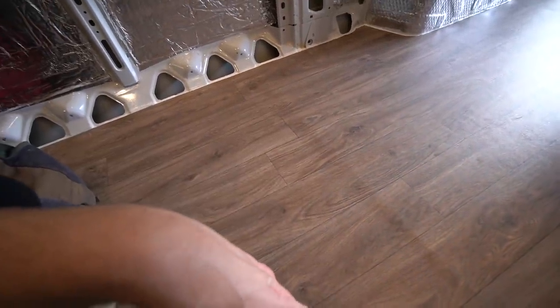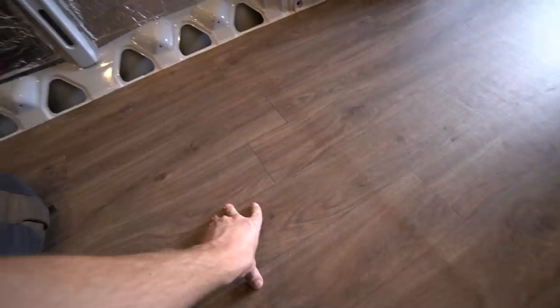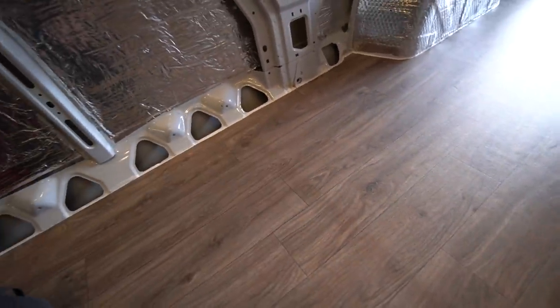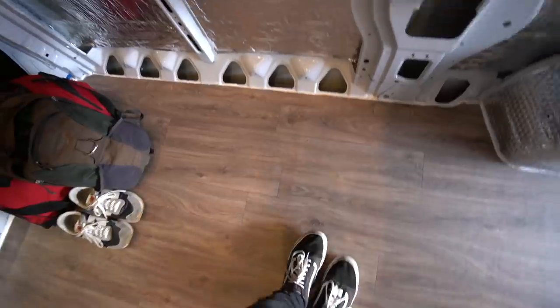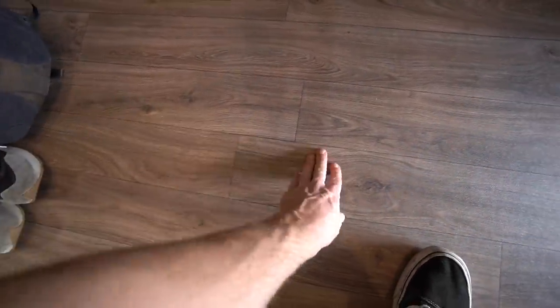Day by day as I drive this van more things are getting added to the list. One thing that's really bugging me is there is now a crease in the vinyl because the ply floor meets in the middle, and this piece here is slightly higher up than this piece - and it's really pissing me off. I think the only option is to screw down in a place where it won't be visible because here I'm going to have units which will cover it. The only way I see of getting rid of this crease is to screw through the vinyl through the ply and into the van floor to make both pieces of wood as level as possible to stop it bubbling. If anybody has any suggestions please let me know.